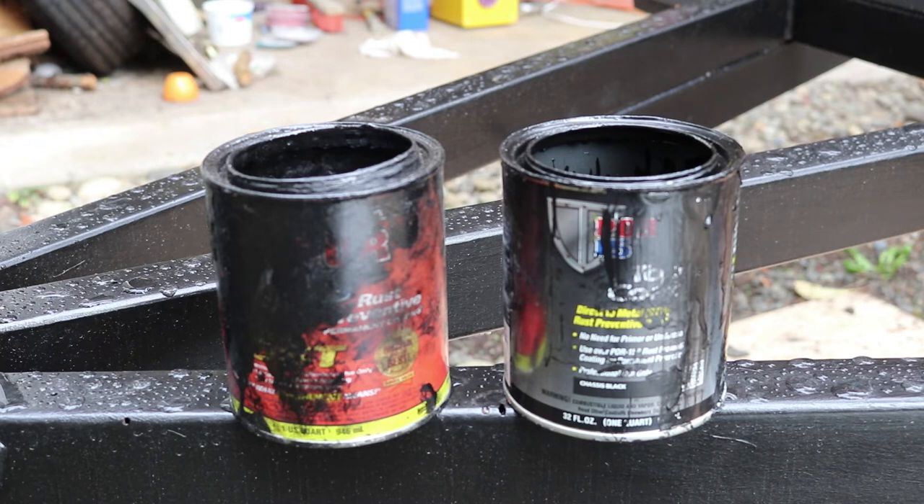Here are the dead bodies — what's left of the POR15 primer and top coat. It took a quart of each to put two coats on the entire base of the trailer. I used POR15 on all areas exposed to outside elements, and the less expensive Rust-Oleum on the enclosed top portion. The POR15 primer right out of the can goes on very nicely — brushed on with a leveling agent, brush marks fade out entirely. No thinning needed; it just brushes right on, sets up, and cures very nicely.